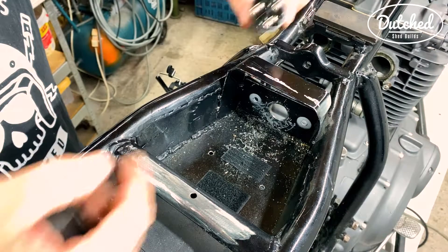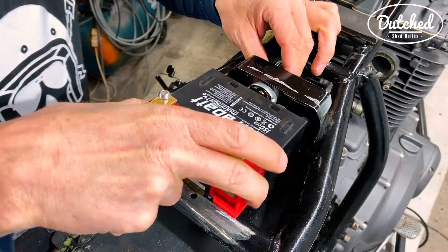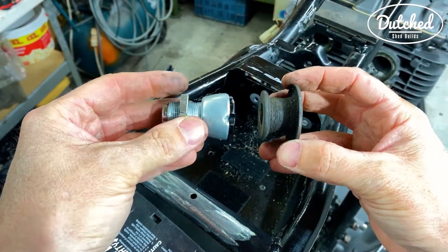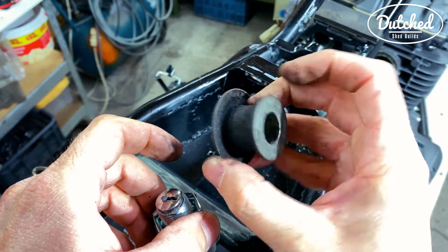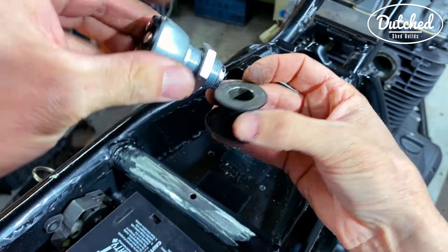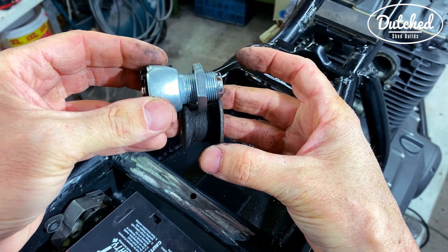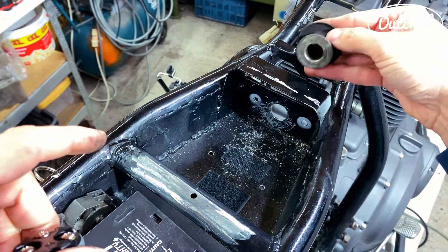The key is coming in too far — the ignition is really tight with the battery. My idea is to take a piece off of this, which is from an old bike. Take off this large piece and drill out this hole so I can fit this in here, then make a little spacer. This will be nice and flush with that side.